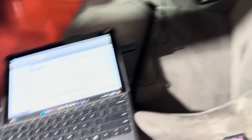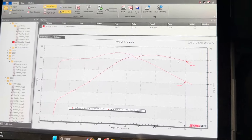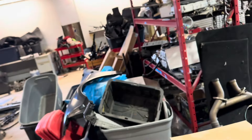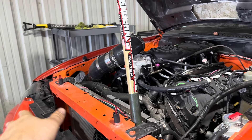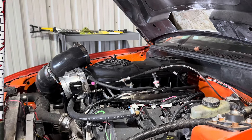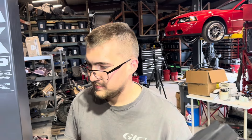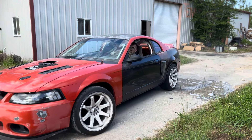Best so far: pretty much all the timing in, nice rich air/fuel ratio running 0.83 lambda — 368 wheel horsepower, 378 torque. We also found the intake was robbing about 10 horsepower due to a little rain guard on it — taking it off made a huge difference in the power band. He might rethink that, though it is beneficial if he's drifting in the rain. We're going to do some testing over the throttle body and give it one last cool down rip, then a burnout.